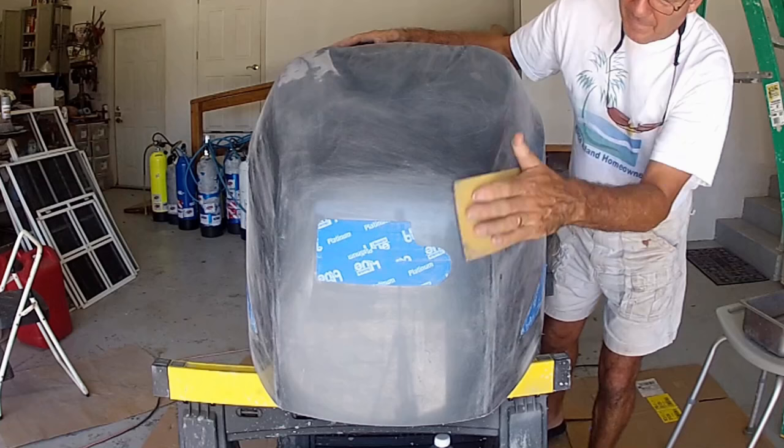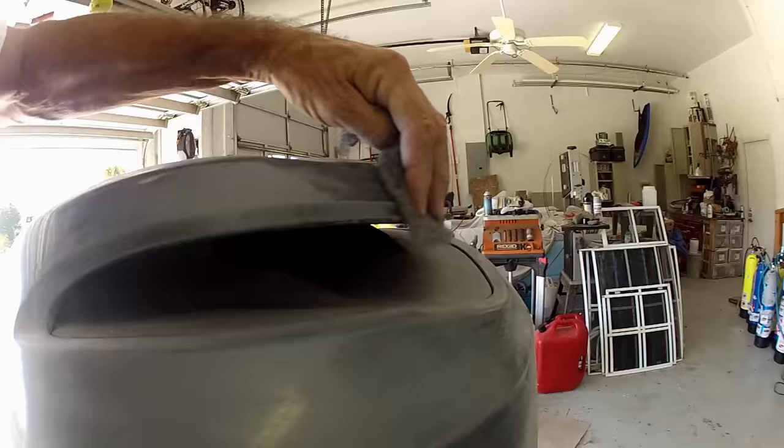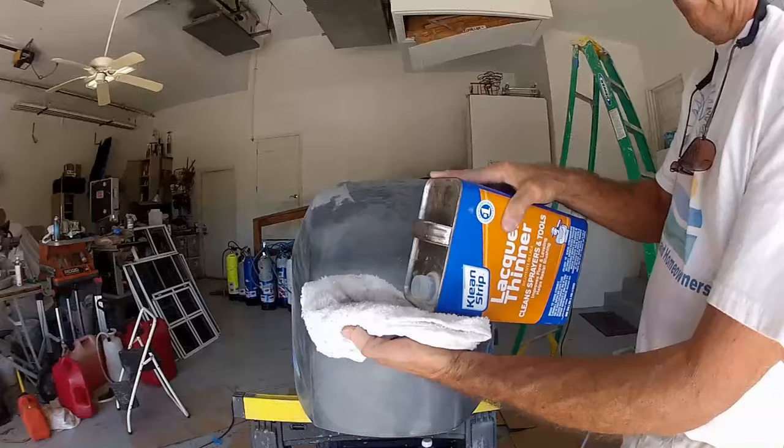If your cover has any damages — nicks, gouges, scratches, etc. — it would be at this stage that you would fix them using some sort of a bondo filler. To finish this rough sanding process, I use a medium to coarse napped steel wool, which greatly assists in getting in and around the edges of the decals and also to cover the entire engine cover before moving on to the next step. Once complete, we should have an entirely dull surface, and from here we go on to our last and final step prior to shooting our primer.